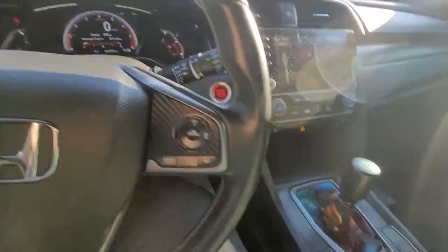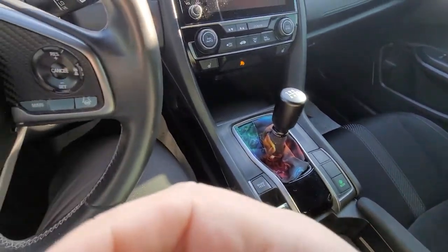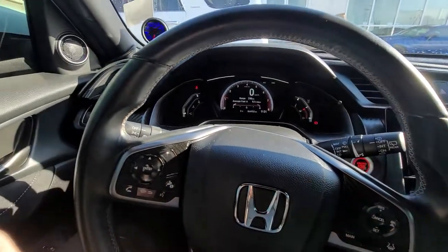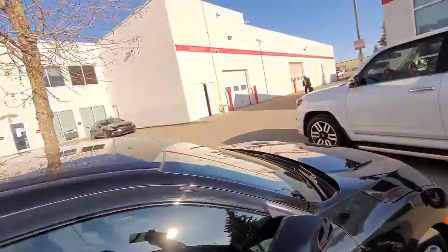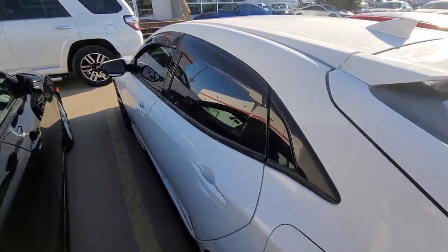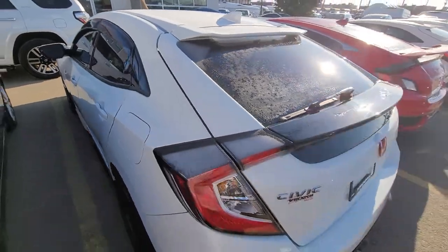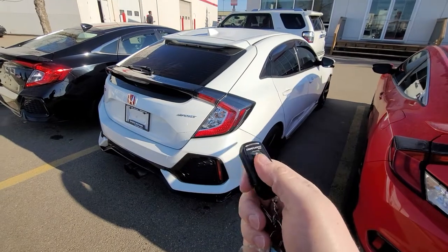So we're going to see we're idling. The park brake's off. We're going to apply the park brake. Then on the key fob we're going to push this button. There's a little click you can hear on the dash and then we're just going to exit the vehicle while it's running. It locks. And then shuts off. As you can see this one's a little bit modified but the CompuStar Remote Start works this way.